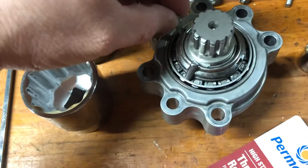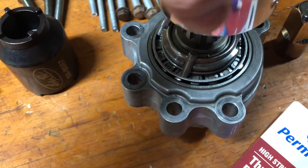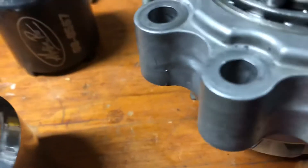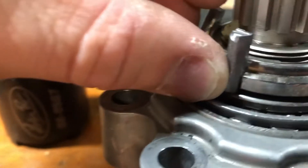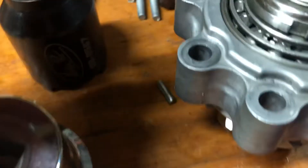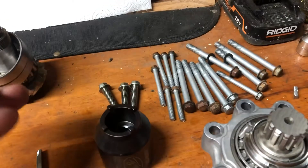I put all four pieces at an angle, then slowly put the socket on and start straightening them up. The goal is that once they're straight, they need to rest on the edge of that bearing — on the inner edge of the race — that's where they end up resting. I also used an old bearing race as a bearing driver a little bit during assembly.